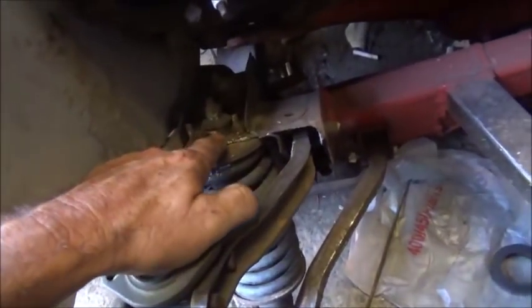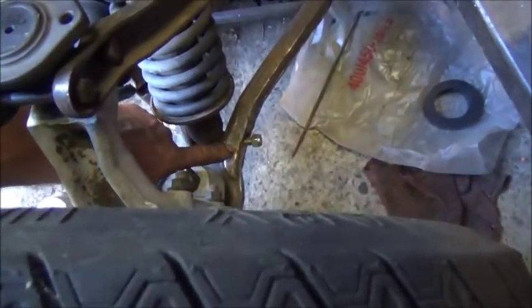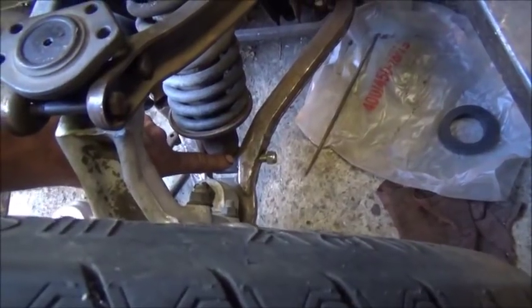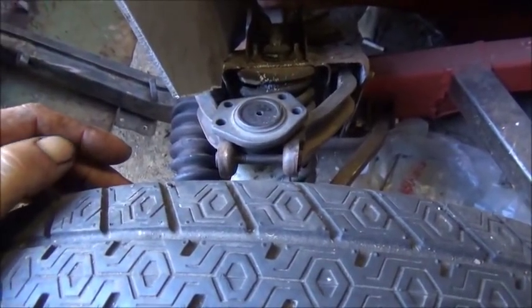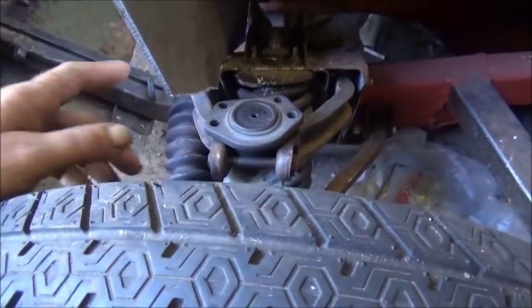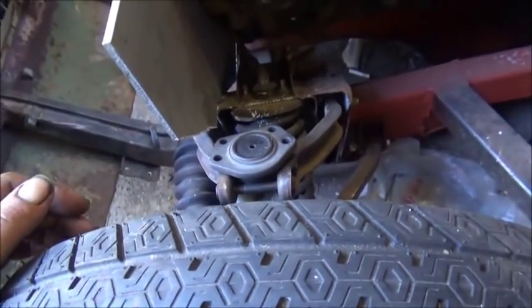Then let me see, if we move it here, we'll run into bolt issues. So about my only way is to make a new bracket for the bottom A-frame and bring this shock up higher. And go ahead and figure out what we need to do on the upper A-frames, and we'll get them made and finished up, or boxed in, whatever we're going to do with them. And the upper is not really as critical as the lower. The lower is the ones that are taking all the heat.